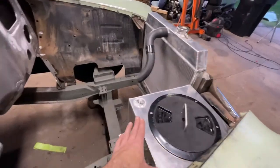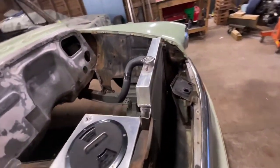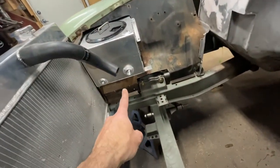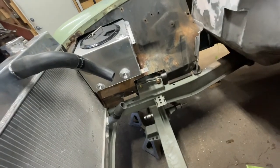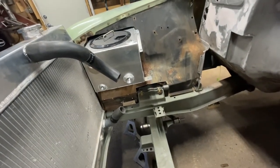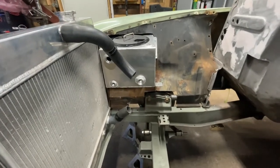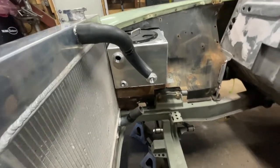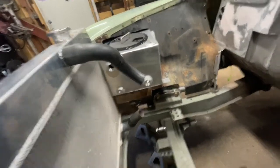I like that a lot. Still going to leak test it because I'm not completely confident in my welds. These tanks come with a 1-inch NPT inlet and outlet - I'm going to cut those off and weld in some 12 AN bungs and keep it all 12 AN slash three-quarter hose, nice and simple. I've got those on order, so I'll do that eventually. I still need to find a place to mount the pump and everything else.